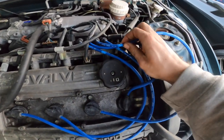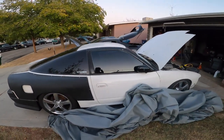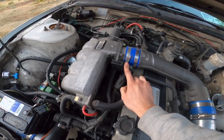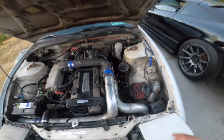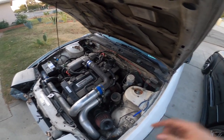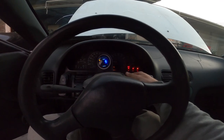I put on the wires one by one so I don't mess up the firing order, but these already come labeled. I also just picked up this S13 — this is going to be my drift car. I've been working on it; it still needs a few things. I already ordered the Origin overfenders for the front and rear. When I got it, the car didn't even want to turn on, but it does have an RB20. I calibrated the TPS to 0.48, made a bracket for the throttle cable, changed the spark plugs, and redid the wiring for the mass airflow. It idles now but the throttle still hesitates. I don't know if it's because it's on the stock ECU, but it also doesn't have an adjustable fuel pressure regulator or a wideband, so I need to get those.